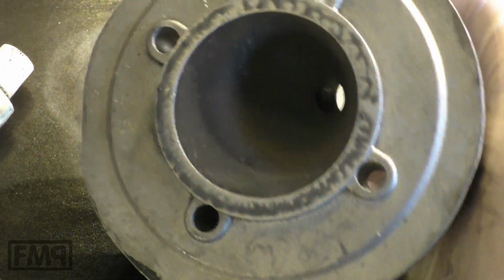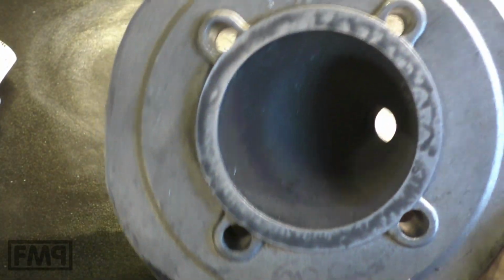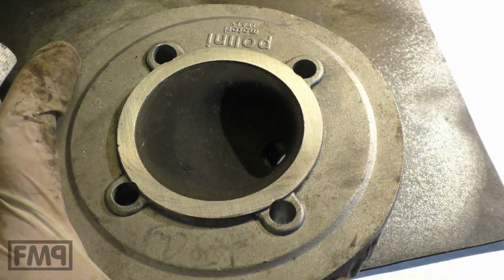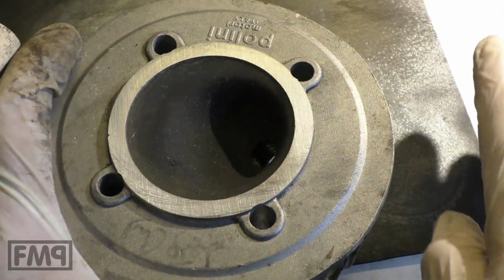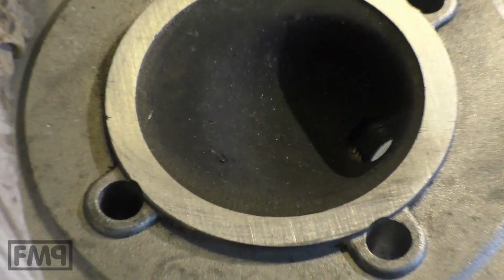Every time you mount a cylinder head, sandpaper it. Even new out of the box, they are not tight. But when mounted properly like that and sandpapered, they are tight with this simple method. Oh yeah, glass plate, whatever, forget it. Take a wooden board, it's fine. Doing this for decades, wood is fine enough. Cheers guys, see ya.